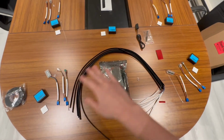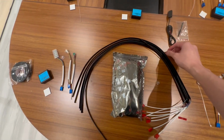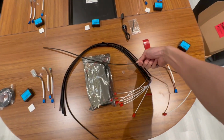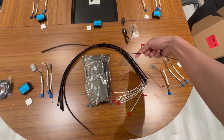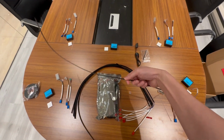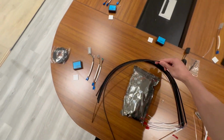If it's a little curly from shipping, you can bend it back. They are flexible LEDs, just no sharp 90-degree turns, just like fiber optic. However, this is not fiber optic in this case, but check it out. It'll bend back really easily and it'll stay in place with hot glue. You can also, if you have both hands, which I'm unable to do right now, just hold it and then run your hand all along and it'll be perfectly straight right after.